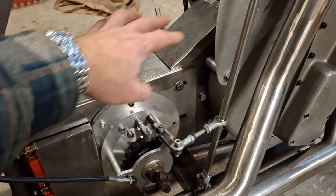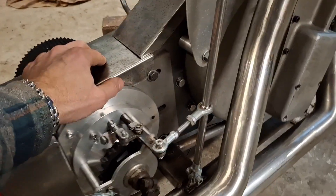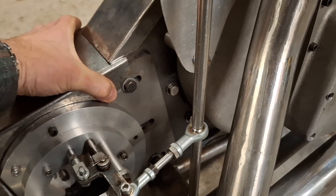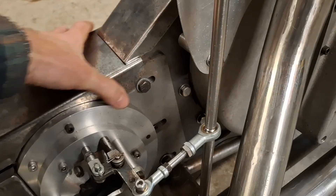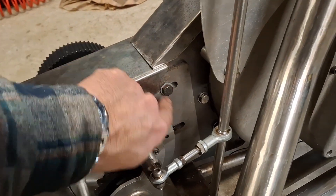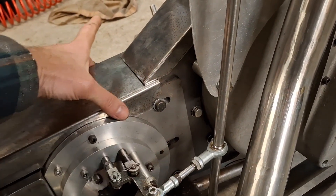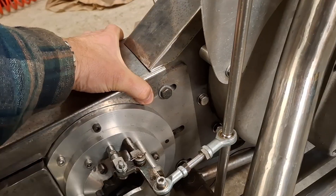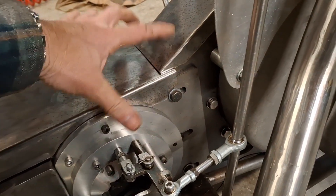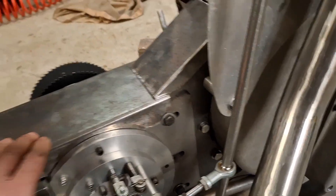Let's have a pop around the other side. That is the other side and again it just looks quite boxy — might just be because it's all the same color and it's a big expanse of the same pre-patined color. So I'm going to put a cap screw in there and the same on the other side. I won't need to slot any of this because the whole thing will move backwards if we need to tension the primary drive — move the whole gearbox back. It's these plates that will slide back, and if I've tapped this plate and put a little M6 cap screw in there on either side, that should be enough to hold it. This will slide, and that piece isn't attached to this, and there's a good degree of overlap there for waterproofing.